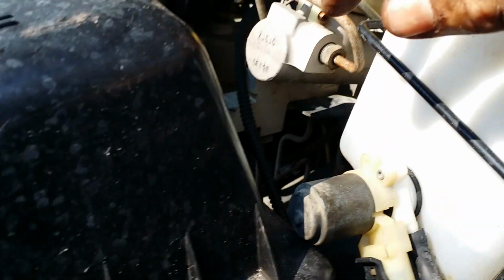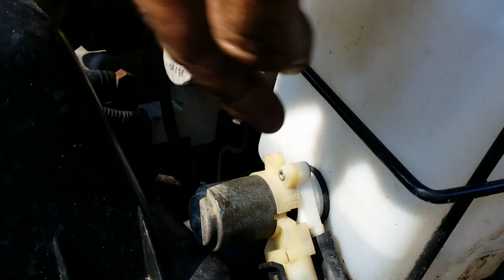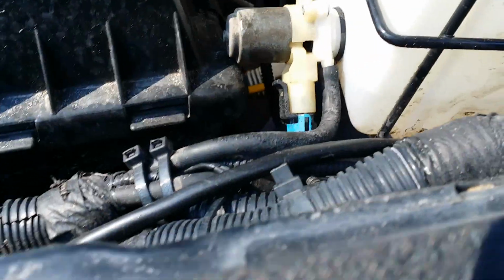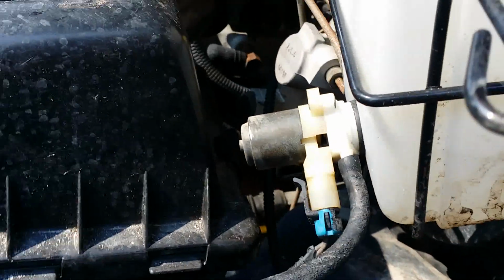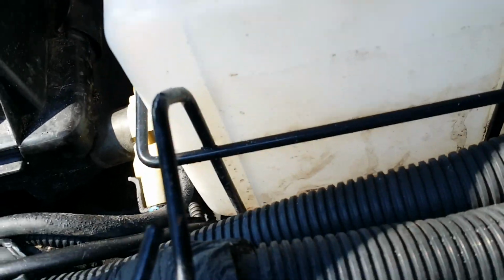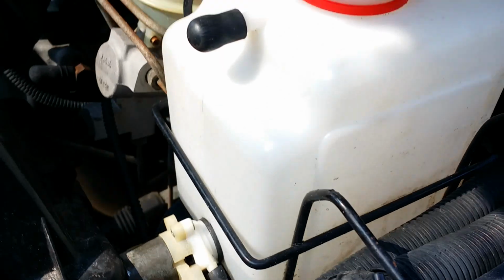This is how I did my water bottle. See this thing out of here? This is just a water bottle, I think I got it at O'Reilly's. For all this, you got to take your water bottle out of your fender to do all this. Well, you got to have water to wash the windshield. So what I did was I took a grommet out of that old tank, and I drilled this tank to fit it, and all your wiring and everything will come out this fender and come around and plug right in here, no problem. And then it comes with this little basket mount, so you just set him down in there like so, put it in there and bolt it down, and there it is. I thought I'd show you all that when we was right here by it, but it went through that firewall, through the rubber well.